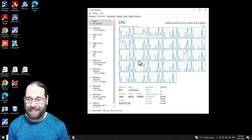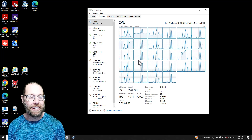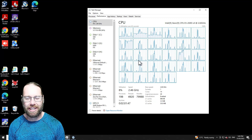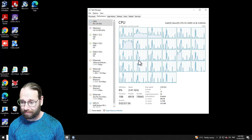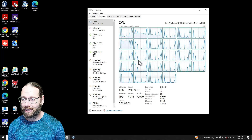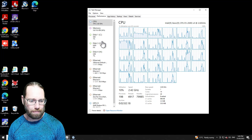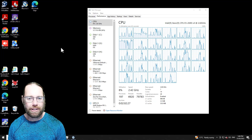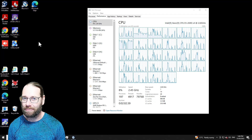Was this upgrade worth it? Probably not worth the effort for any 10 to 15% performance improvement, but we might see an improvement in power usage since we've gone from 22 to 14 nanometers — though the TDP on the new CPU is a bit higher given the higher clock speeds and extra cores. So the upgrade was a success. I definitely need to update Windows — I think I'll throw an NVMe SSD in there, extract the Blue Iris configuration, and do a fresh install. But that's the subject for another video. I'm Alistair, I'll see you in the next one.